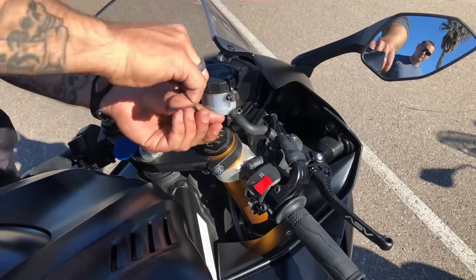Now, what's the test for the rear? It's the same test, but there's no settle at all because there's no engine weight over the rear. I'm going to push down like doing a chest compression — CPR style. I'll need your help: hold the front brake, bring the bike upright, keep it balanced, and don't let it move. I'll push down hard, straight down, and it should come up as fast as possible with no movement whatsoever afterward. Let's see what it does.